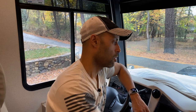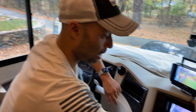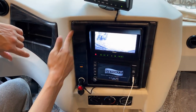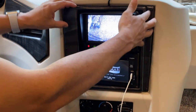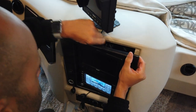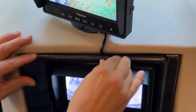Guys, so we're back. Everything is set up, it's done. Just a couple of things, okay? Originally we had the wire coming around. That's an easy way to do it: you just wire and plug into your 12 volt here. What I did was remove this part of the dash. It's just six screws, very easy to do. Unscrew the six, pull it out, and then I took a Dremel tool and carved out a little notch here. Literally a four-minute job. Put it back on so that wire is nice and tucked into that notch.